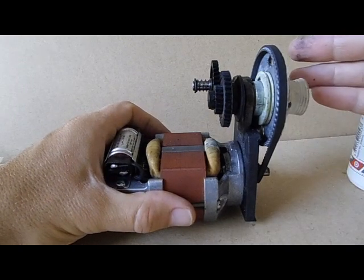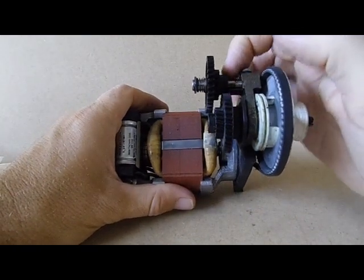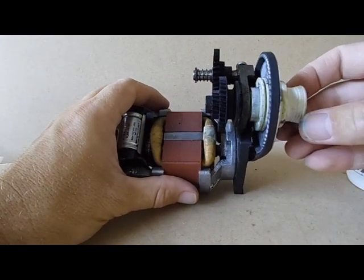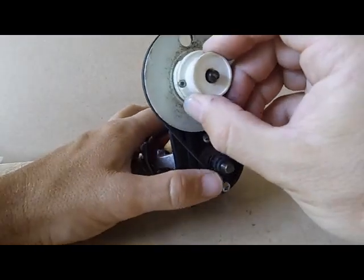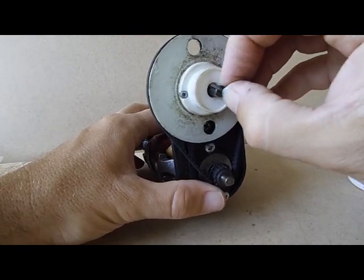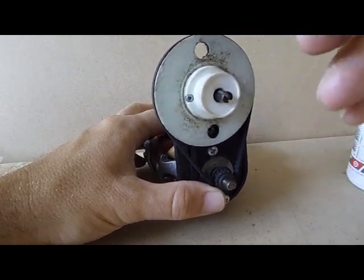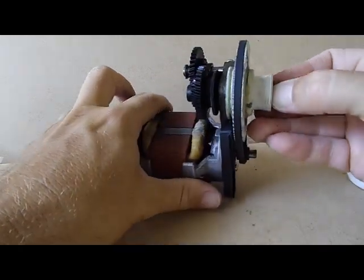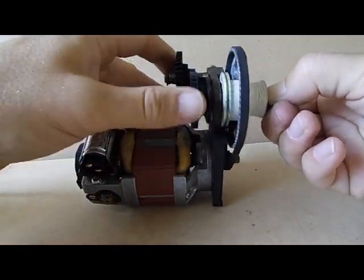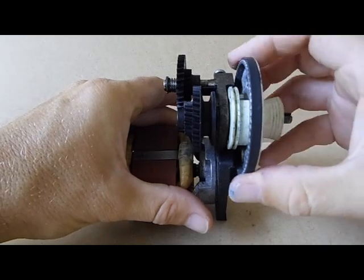This system can fail. What I've noticed is that over time, this little shaft can get dry, and when you pull this back, it won't slip back in again. The other thing I've found is that when it's pushed in, the little clip that engages your bobbin doesn't work anymore — it doesn't shoot back, it can be stiff and full of grime. When it's locked in like that, you can turn this little wheel but it will only work once you release that little clip.